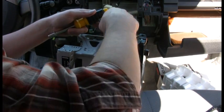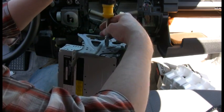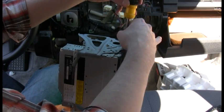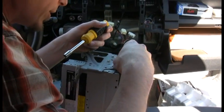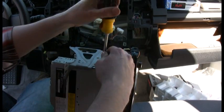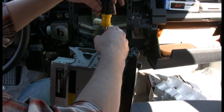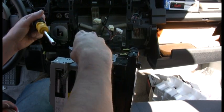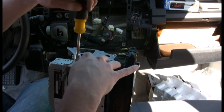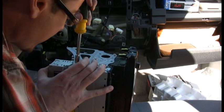I'm going to steal one of these bolts from the front because this one didn't have one. You definitely want both bolts in, because any movement at all and you're gonna have skipping issues.